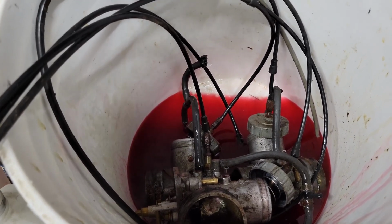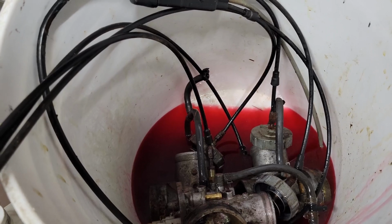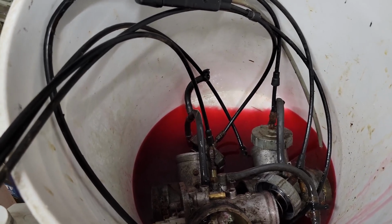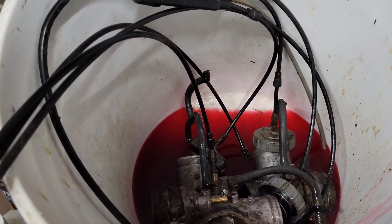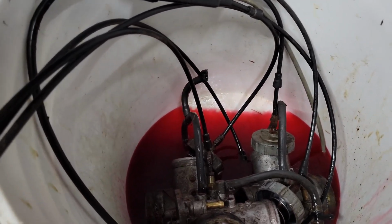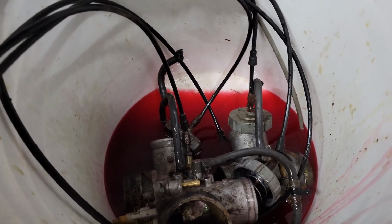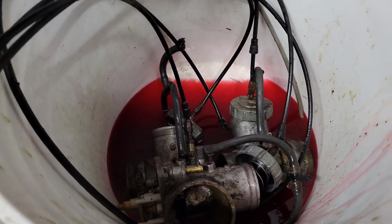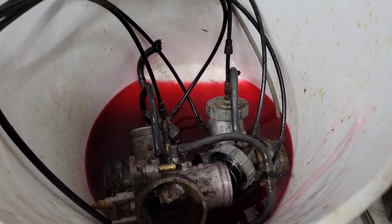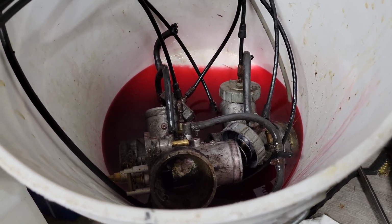As of right now, the brakes, they're still kind of locked up. Like it's moving, but it's not. So we need to determine if that's the caliper or if that's actually the lever itself. I'm thinking it might be just the lever, but it very well could be both. We need to figure out what the problems are and what we need to order. Because again, we don't want to put too much money in this, but I want to get it started. So I'm going to see if I can reach out to Jet Motorsports again and see if they have the parts for the brake as well, or if they can locate them. And if they do, we'll have it all together and we will move forward and get this thing taken care of.